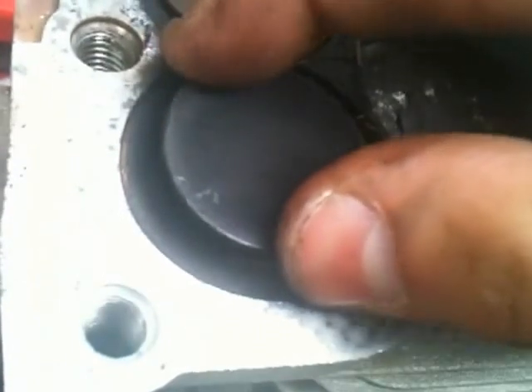Which tells me it's the valve that's getting stuck and not the actual crank part in the bottom. Also because when it does seat, there's about a millimeter of gap in between. And the other reason is because when this comes up and you try to turn it, it's really hard to turn, which means it's really sticky. So now I need to get that off and see what I can do from there.